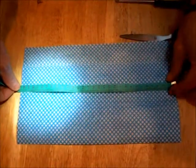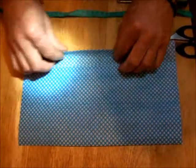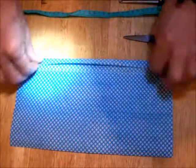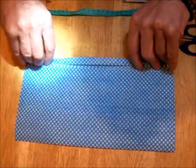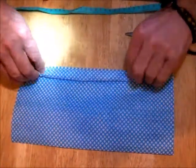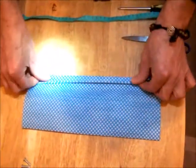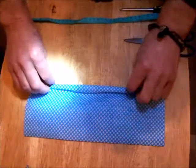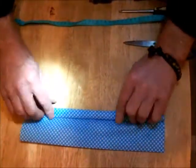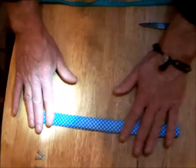All I've got to do is, once I've put the bracket back onto the vacuum, fold this across, making sure that the width is about a centimetre, maybe a bit less, and just keep folding as I go along. In fact, you can just roll it along really like so. And the idea is to make a thick wadding that will go along the front bar of the vacuum and raise it up, because the suction is just far too powerful. And this is what causes the problems, and this is the design fault. There you go, all done there.